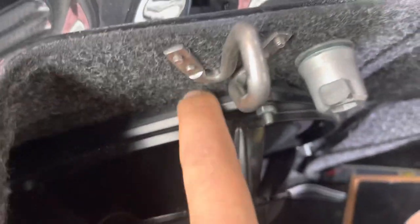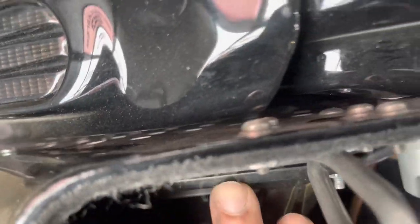The 6x9s are screwed directly into the side of the bag with no spacers, so I'm sure that the 6x9 is hitting the bag and causing rattles. And then they drilled a whole bunch of small, tiny holes instead of routing out a 6x9 opening and covering it with grill or some protective material.